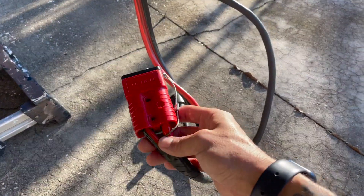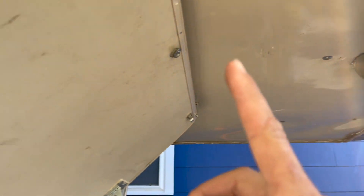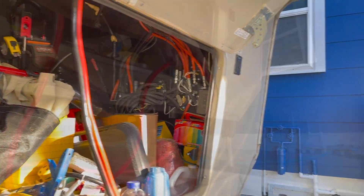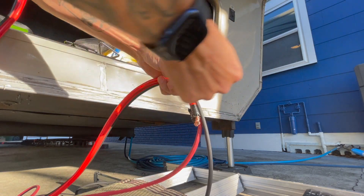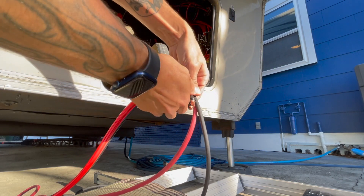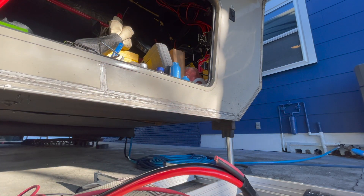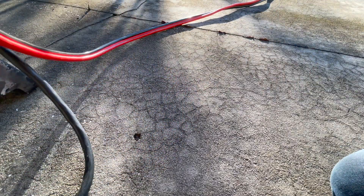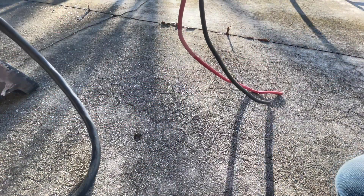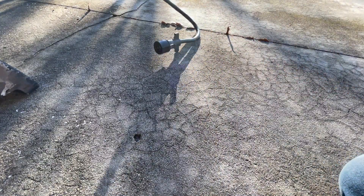Here I have my old DC-DC charger connecting cable, zip-tied up to my seven-pin connector. The first thing we're going to do is clip all these zip ties, then run new wire to replace it. We're going to tape the old cable and new cable together for a quick little tape job to run them together — there shouldn't be any snags. Now we're pulling the other end and feeding it through. We got it through to the other side — we can pull the old cable out and now we have our new cable.